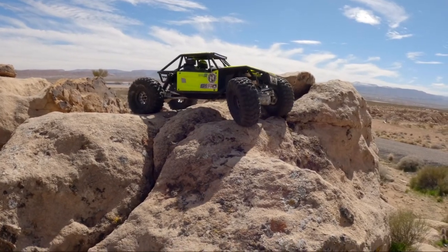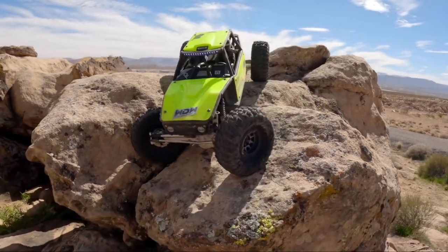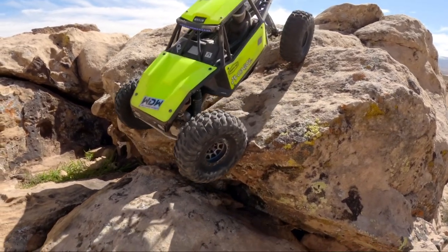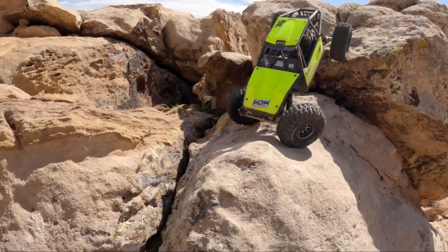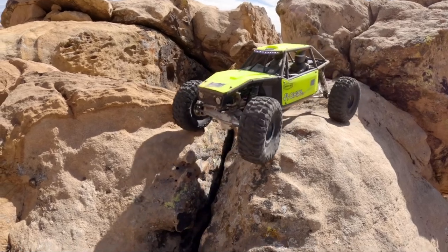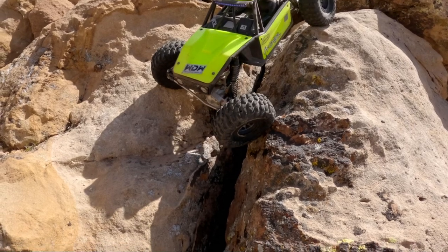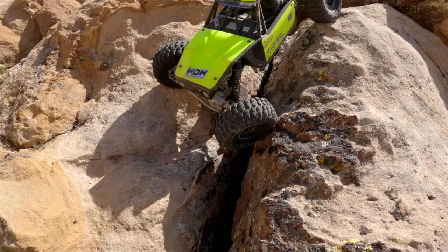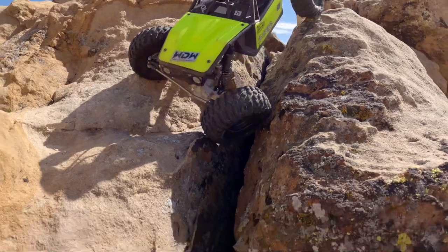That's one of the little tricks I use driving through corners on long cracks — try and get that rear axle as level as possible even through corners, and you can use your steering to help do that. But you've got to have a strong servo to do it. This car is running just a little bit of overdrive — I believe I have an underdrive gear set in the rear axle. Going to try and front dig across here hoping that left rear holds me level enough to not let me roll.